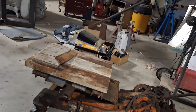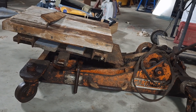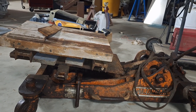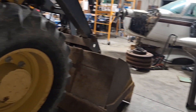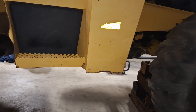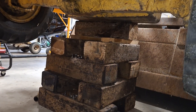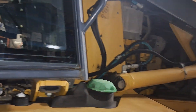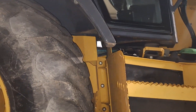About 35 years ago I bought this transmission jack — used it last about 20 years ago to take the transmission off an auger truck to change the release bearing. It's been sitting in the barn but it still works. The book tells you to lift it up 37 inches. I had to go in through the door with my engine crane and drop the transmission down to the floor, then drag it out.